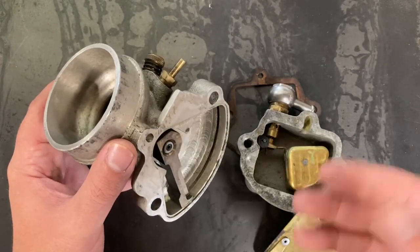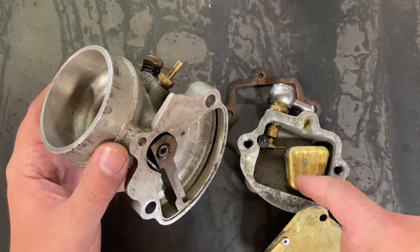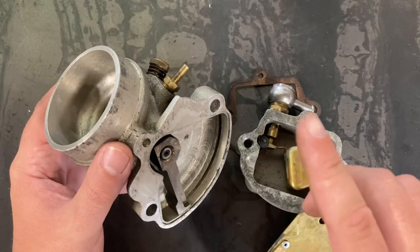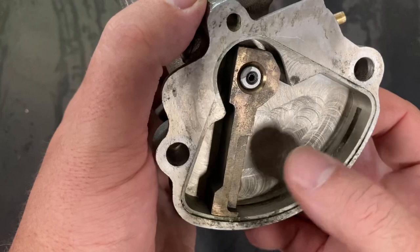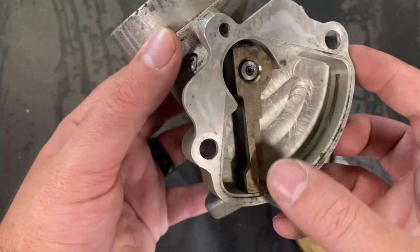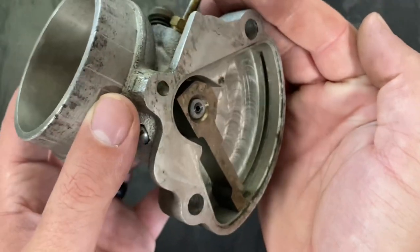The float circuit is simple — it's the same theory as the previous carburetors. You have your flow coming in, filling up this void, the float moving up and stopping your flow. Where it gets a little different is when fuel enters the void past this brass sheet. This area gets filled up with fuel to a certain height, and in an idle scenario your throttle plate is going to be completely closed, so your arm is going to be to the far left of the void. If you look closely you'll notice a groove.